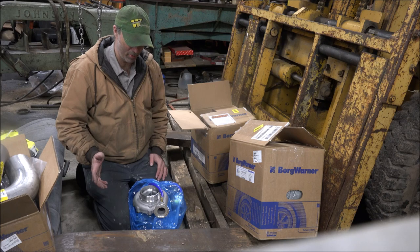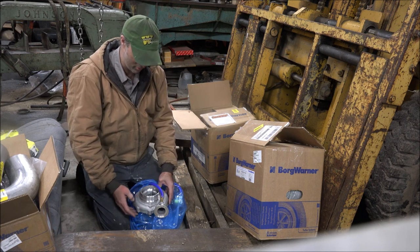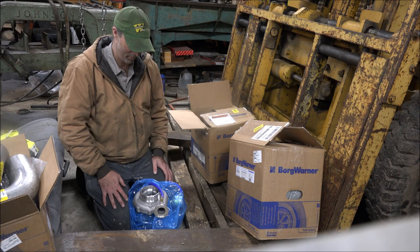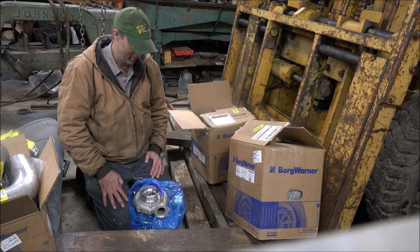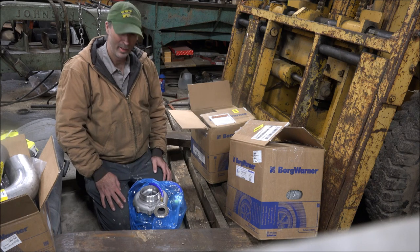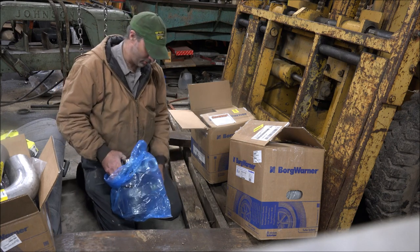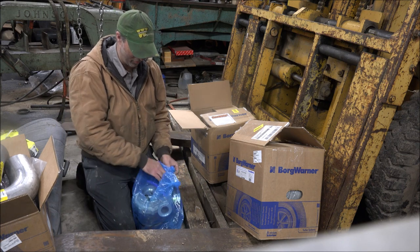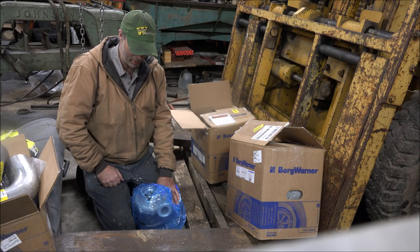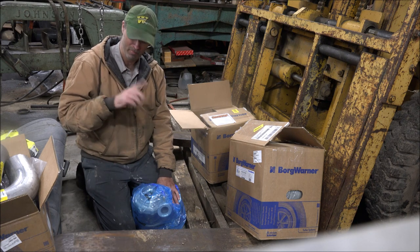You're not going to have 1200 RPM boost with a 66, but you can have 1200 RPM boost with this charger. That's what I'm after, particularly with my 307 gears — my truck runs very little RPMs and we're trying to get 20 miles a gallon. Even after the injector change I did a while back I'm stuck right there at 19; I haven't been able to do any better average than that. It's hilly around here and it takes more fuel to go up and down hills. That turbo is going to go on the manifold, and I made this just for testing purposes — to run it as a straight manifold first, just to see how much of a difference it makes over the 35, before I flip the manifold and put it in a twin kit.